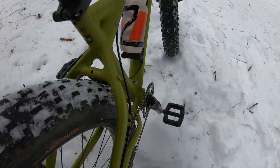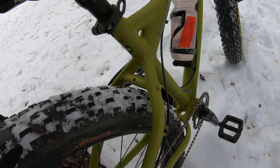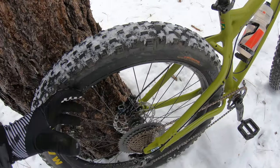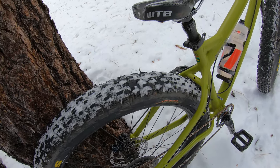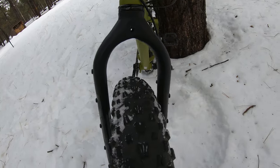There's quite a bit of clearance in here — even with the chainstay slammed we've got a quarter inch at least in between the seat stay bridge and plenty of room over here. I'm sure you could fit 4.0s no problem. Plenty of clearance down here. You can also extend and retract the wheelbase if you want a longer wheelbase, but I'm short on a size small so I want the shortest wheelbase possible. We're running the RSD rigid aluminum fork up front with plenty of clearance.